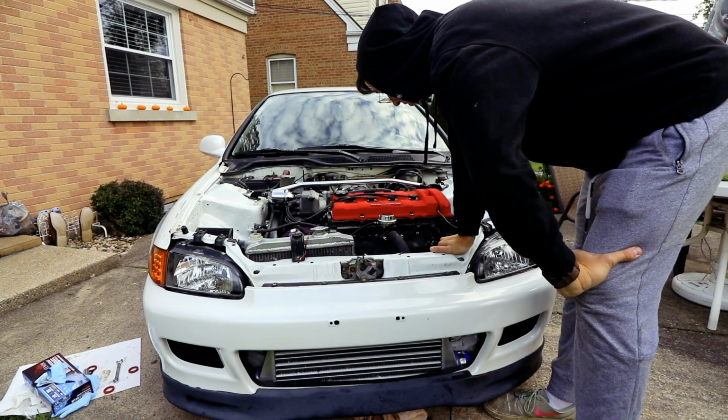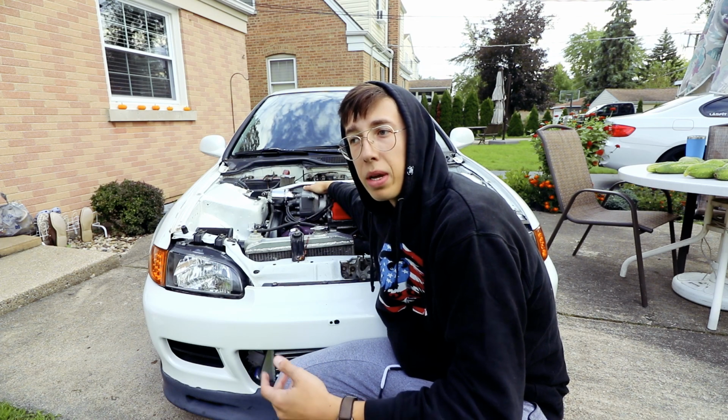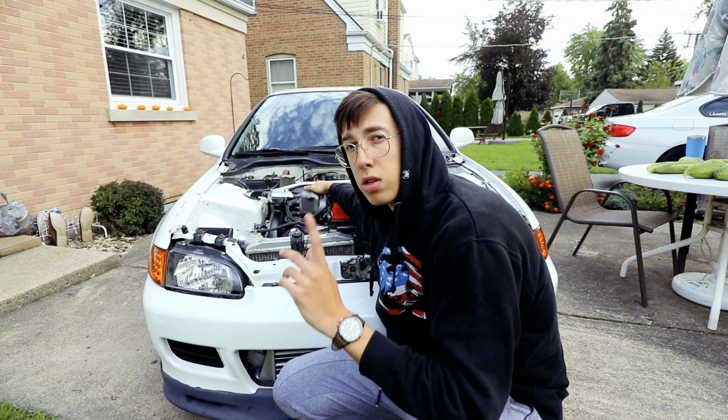Sounds good to me. I just located a fat coolant leak. It's actually something super simple. There's just like a little nipple underneath the distributor, and there's a rubber cap on it capping it off, and the cap was broken. So I need to figure out a way to cap that off. I think I have one, but I'm not sure. So I'm gonna look.